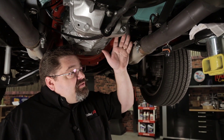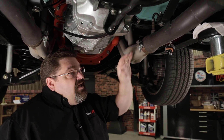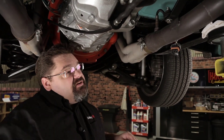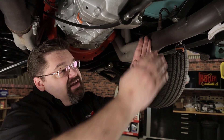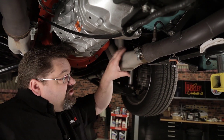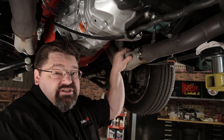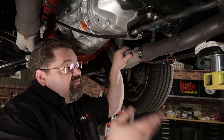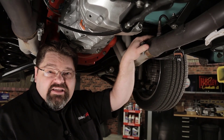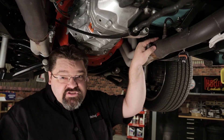We want to pay particular attention to our O2 sensor placement. Ideally, it should be at least 6 to 8 inches back after a merge in a set of headers, and you want at least 18 to 24 inches of exhaust after the O2 sensor. That helps ensure a good mix and average of gases off at least 4 cylinders and eliminates chances of atmospheric reversion giving you false lean readings. Make sure you're using quality hardware clamps — you don't want any exhaust leaks upstream of the O2 sensor, as that can also give you erroneous readings.